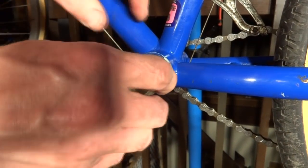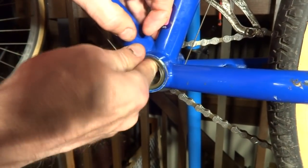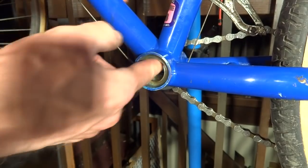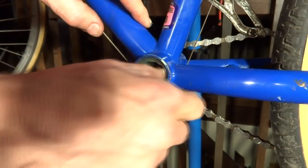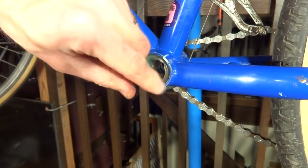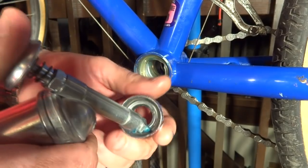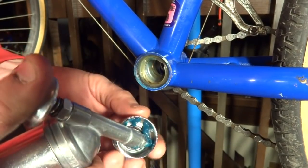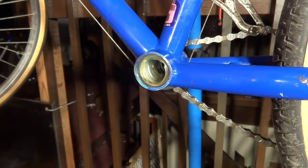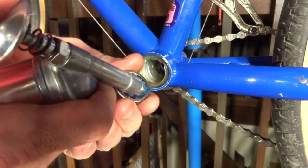Next, go ahead and insert the little plastic liner and just push this in. This helps keep dirt from coming down through the seat tube or down tube — there are little holes where stuff can come in, so this will help keep dirt away from the bearings. Now I have the adjustable cup, and I want to go ahead and put a line of grease around in the race, just like I did with the other cup. And I have the new bearings, so I'll put a little bit of grease between the bearings on this side.